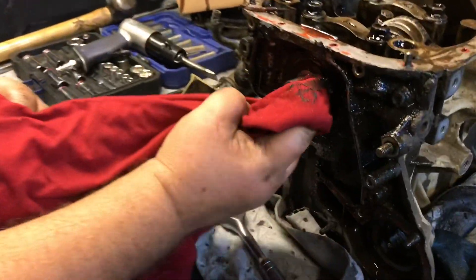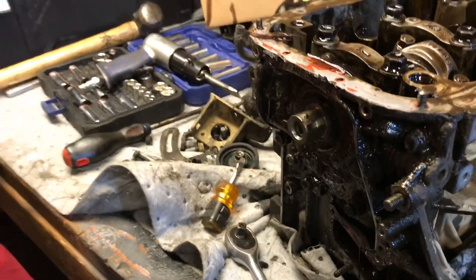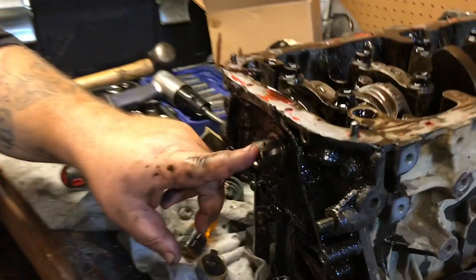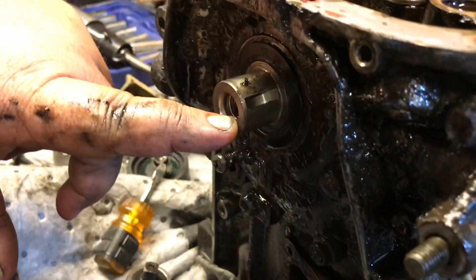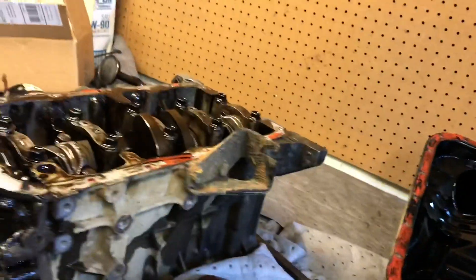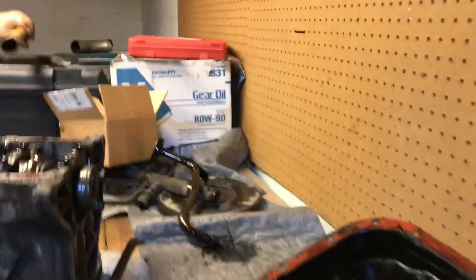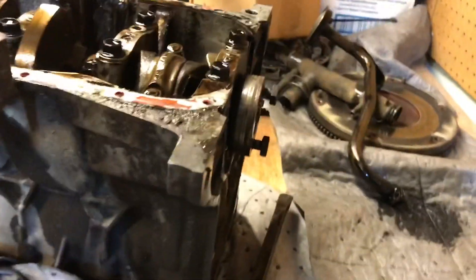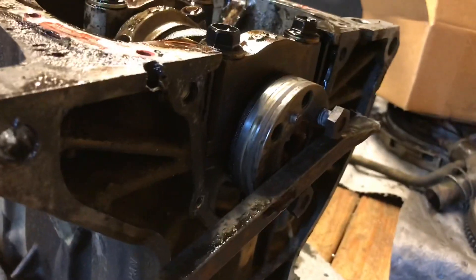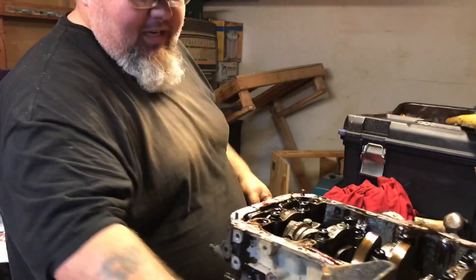What we had to do here is on the front of these little motors, it's got the crank bolt — 17-millimeter nut — and they are put on there with the same force that was released on Hiroshima back in the 40s. So we actually had to use a long pry bar and an even longer pry bar on the end of a ratchet to snap that bolt loose, and then put two of the flywheel bolts in the back to hold it. You just had to hang off the back of it — sometimes you've got to improvise.